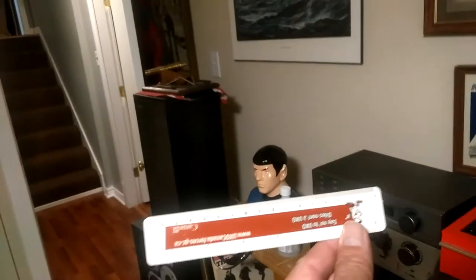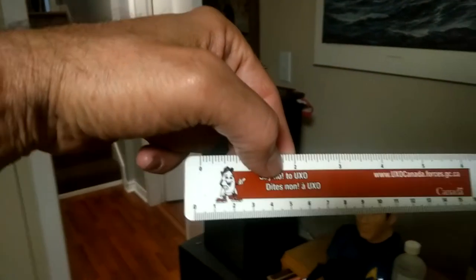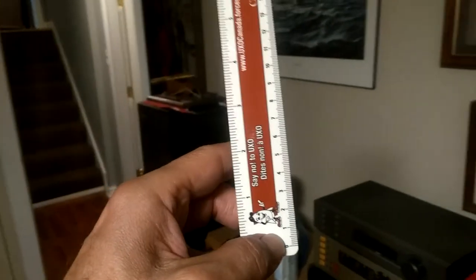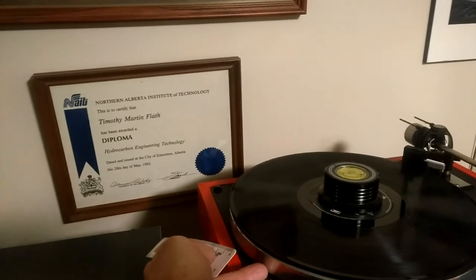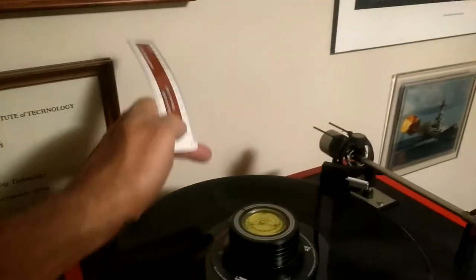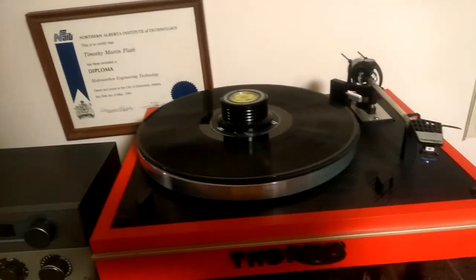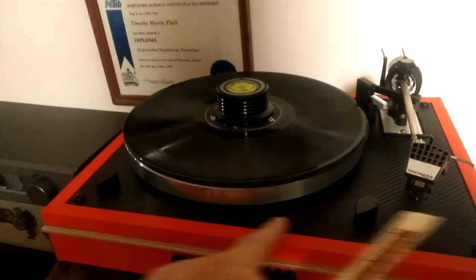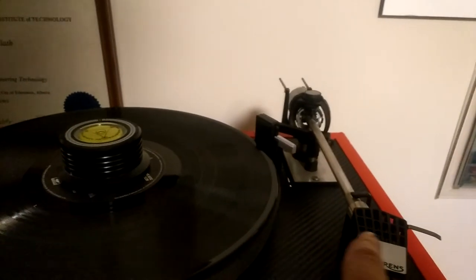A trick I've found: I've got these neat little rulers from the UXO program I used to belong to. I'm going to keep this with this turntable and the one upstairs. What I'm doing is measuring the distance from the top plate to the underside of the outer platter assembly, and I want to have the same distance all the way around so it's nice and even. I've got the bubble in the middle, so everything is totally balanced, and the top plate is true both forward, backward, sideways, and angular.